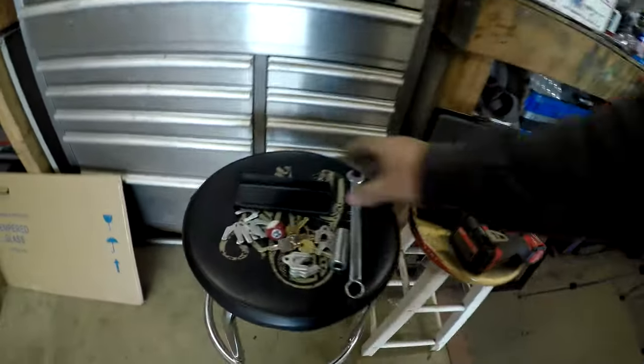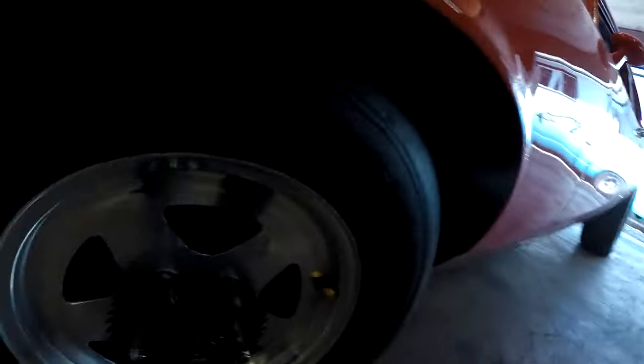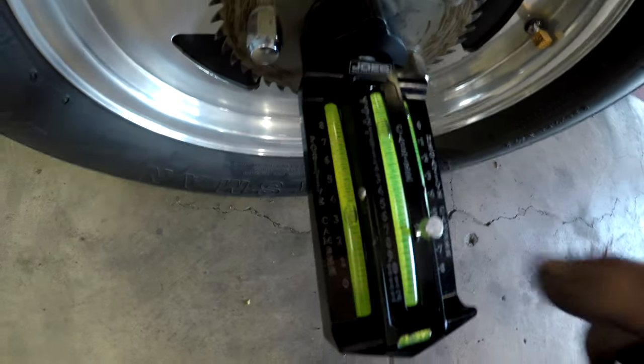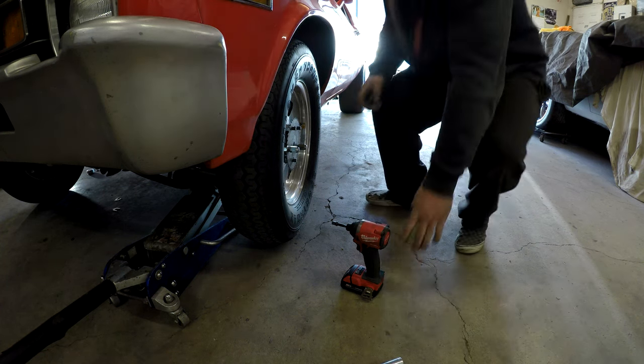On the driver's side, I took all the shims out - I had put a ton of shims in there and it was still one degree negative. So I took all the shims out and now it's three degrees positive camber, which is way too much. So I'm going to do the same thing I did on the other side - screw the control arm in all the way, see how it is, then add shims as necessary. I just don't want to have five million shims in there. I'll also show you guys how good my new Milwaukee gun is.